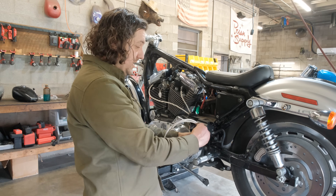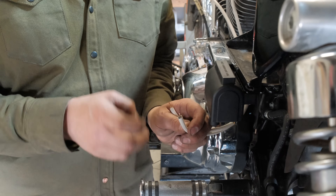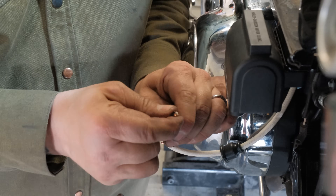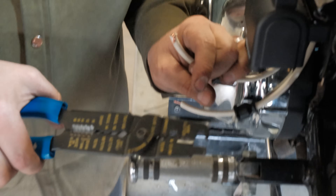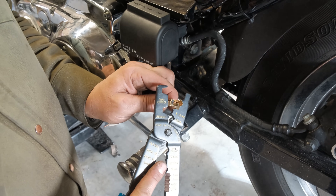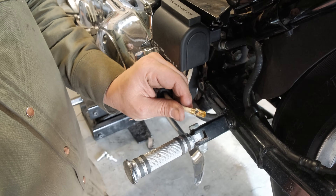Now we'll run our spark plug wires. For our kit to reach, you need two sets of spark plug wires because you've got to go down, up, and over. These are our cloth-covered spark plug wires. They come with the spark plug end already attached, and you just cut them to length and crimp on the terminals that go on the coil. Once you've figured out where you want them and cut to length, slip your boot over the spark plug wire. Take the terminal ends that come with it, fold it over so you get a good connection, and take the W crimp — most pliers have a W or spark plug terminal crimp. Line it up, stick your spark plug wire in just a little so the crimp will catch it, put your crimp connector on, and send her home. Move it back and forth to make sure you get a solid connection.